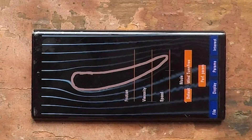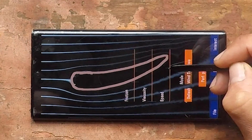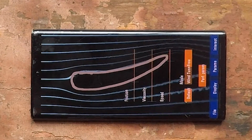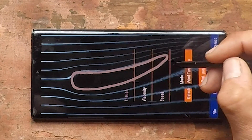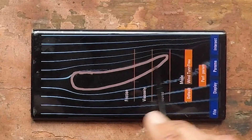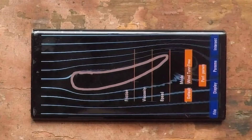You can also play around with the speed that the wind is passing over the wing. As I move that speed rate up, you'll reach a point where the wind becomes unstable. At those higher speeds you start to get inconsistent attachment to the underside of the wing — it starts to roll around and every now and again just break away, because we've reached the stall point of the wing. If we go even faster you'll see how chaotic it becomes. At high speed with this kind of situation going on, your car becomes incredibly unstable, which is the last thing you want. So designers have to design wings with the correct profile but also at the correct angle of attack to enable them to work at the speeds for a particular circuit.